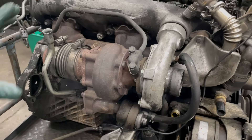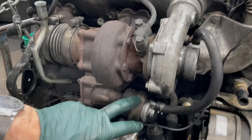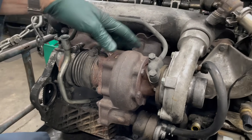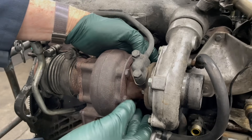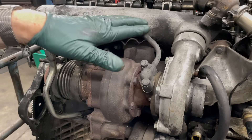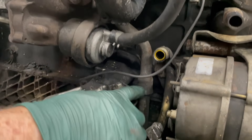Right here is where you have the exhaust entering the turbine housing — this is the exhaust turbine housing. Down here is the wastegate assembly, which prevents it from over-boosting the engine. And here's your exhaust through this flex pipe. This enters the center section right here forward of the turbine housing. There's a big oil tube coming right in and dumping on top of the center section. This is not high pressure oil — this is high volume, literally pouring through the center section and dumping back into the pan through this tube right here.